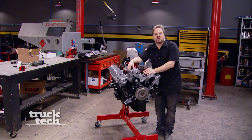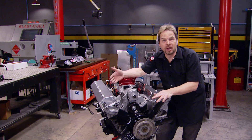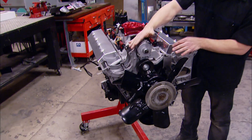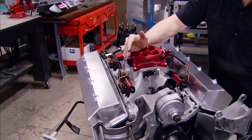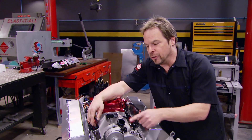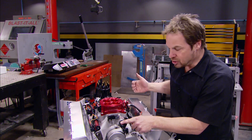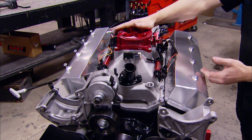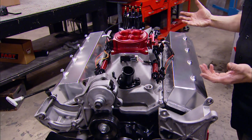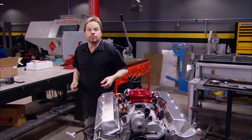Welcome back to Truck Tech. The engine is looking great, and we know it's going to run every bit as good as it looks, if not better. We've got a head start on the accessory drive, the water pump, the cooling, and the FAST EFI. Now, this is the water neck — not a vent tube like in old-style V8 engines — and there's no place on either valve cover for crankcase ventilation. We've got to have a vent because pressurized air will find its way out through a gasket or seal.